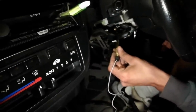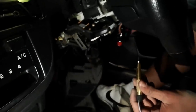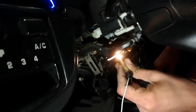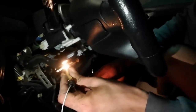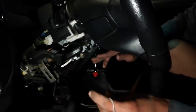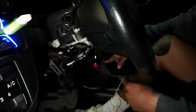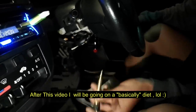That's the constant power to the ignition. That wire doesn't have any power, nor does that other wire right there. So if I switch on the ignition - that's still the constant power, and that one right there is basically the ignition power wire. I will be connecting the remote wire of the harness to this wire. The fog lights will never go on if the ignition isn't turned on. So when I turn the ignition off the fog lights go off, and when I turn the ignition on it sends power through to the switch, then I press the switch and the fog lights go on.